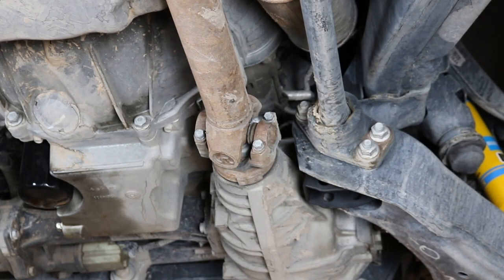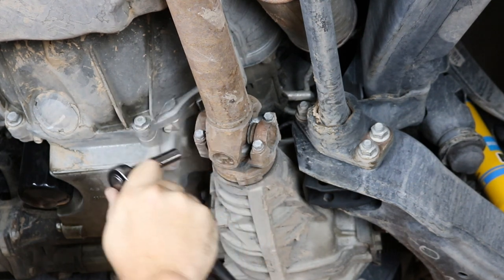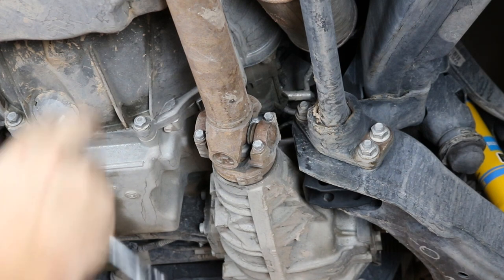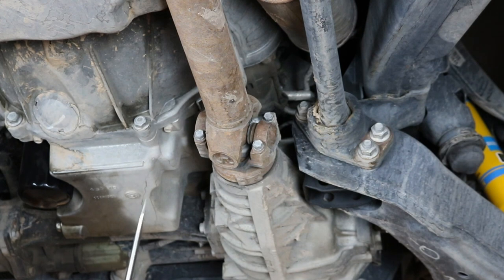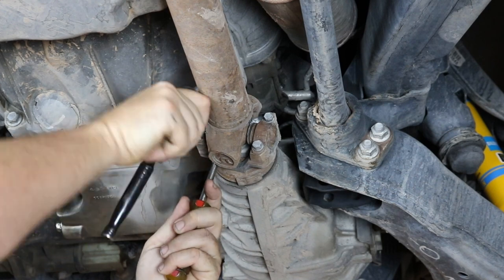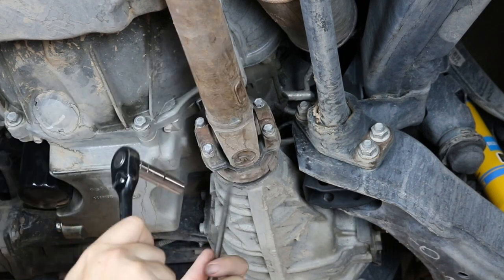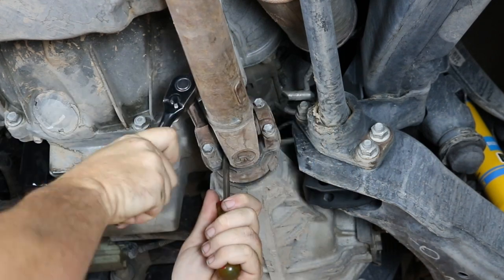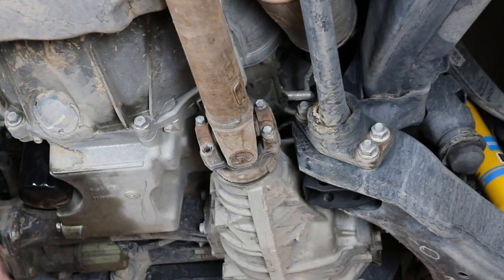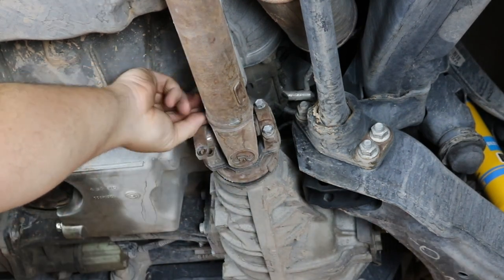The first thing we're going to do is remove these U-joint strap bolts on the front of the front driveshaft. The purpose of this is so we can put the driveshaft out of the way to get to the bolts on the transmission pan. The easiest way to do this is to put a screwdriver in here to keep the shaft from turning as you loosen the bolts. These particular bolts have a 7/16" head. The bolts on the other end of the shaft are a 10mm head, but that part of the shaft is harder to get on and off and you don't really have to remove both sides.